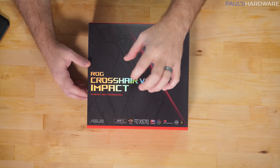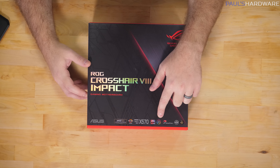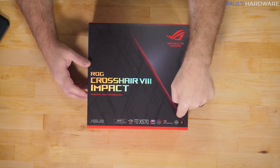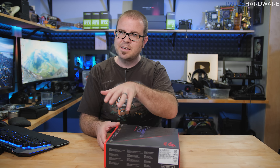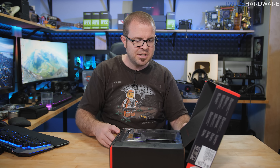It has a really cool SODIMM.2 feature that lets you install extra M.2 NVMe drives to the board, Aura Sync compatibility for RGB, and ASUS node compatible as well, as well as PCI Express Gen 4 support. That's thanks to this being a Ryzen 3rd gen series motherboard, although it's only going to give you PCIe Gen 4 if you use a 3000 series or Ryzen 3rd gen processor.